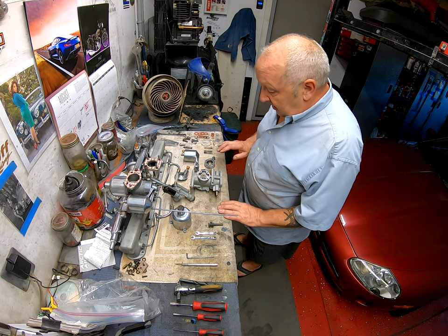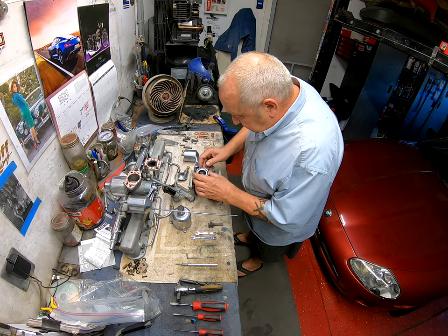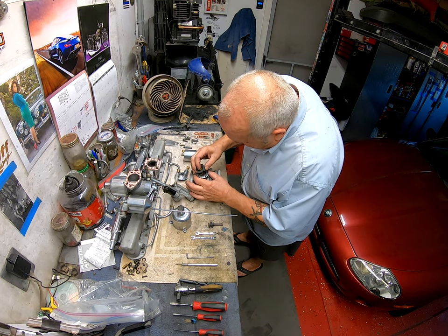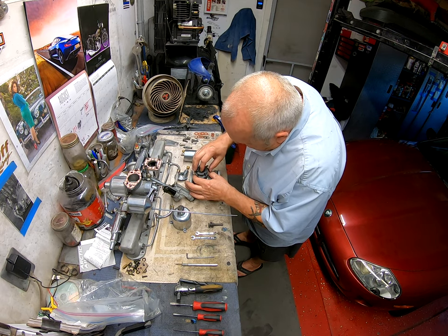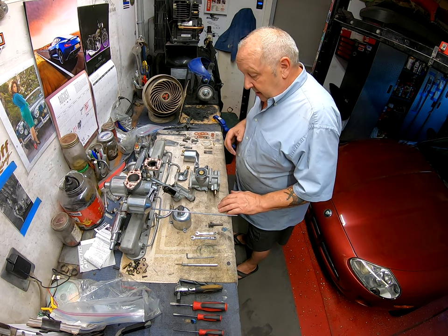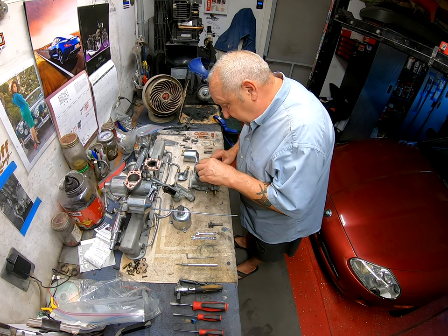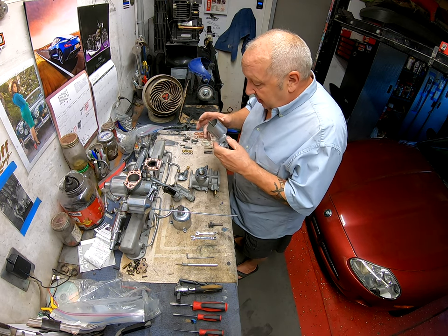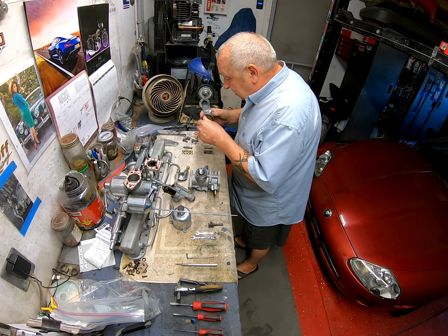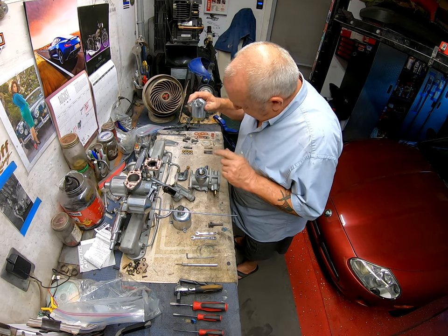Let's get this on the bottom here. First we place this on, then we insert the diaphragm. Now I know this was covered in my previous video but I like to do it just in case. It's getting awfully hot in here and I've had to turn the fan off because obviously that would destroy the video. Then don't forget the spring, which actually comes in the kit. Then grabbing your trusty float - just gonna put this on here, it stops the float from falling off. Lining it up properly - okay, that's good.